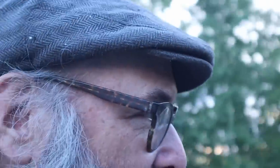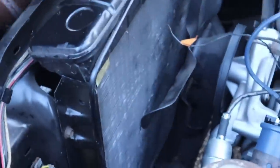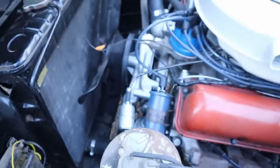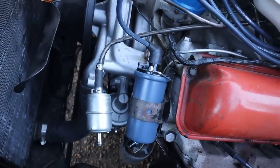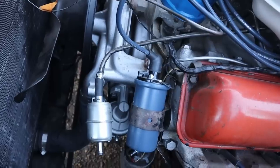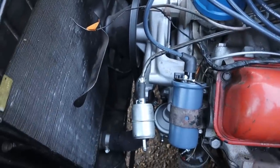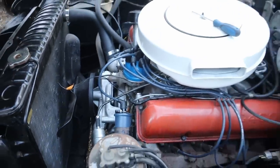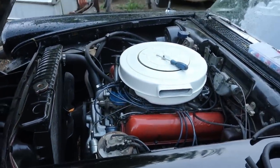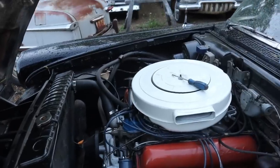The Team Edsel fuel pump, which looked really nice, was defective and lasted less than 100 miles, or less than 500 miles. So here we are. Miles used his noggin, and what did we order this from? A '74 F-350 Ford, 390. With a 390, it uses an FE pump, so we stuck it on there. It's short of a concourse where this car is never going. It should be fine. We hope. So we're about 5 minutes from test firing the old Edsel.